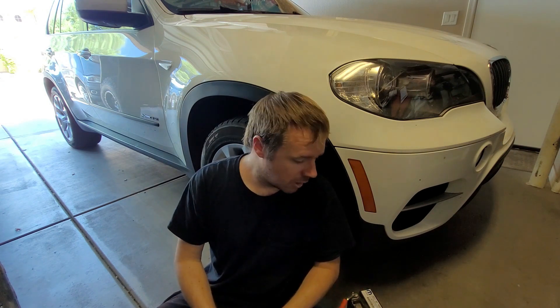It's an emissions thing so the vapors don't go out to atmosphere — it also saves gas mileage. There are some codes you can get with this. Specifically today I want to talk about P0442, which is a small evap leak. There are a few different problems that can cause this code, but I want to talk about the purge valve — that valve that opens and closes to relieve pressure and vapors off the top of the tank and burn them in your engine.